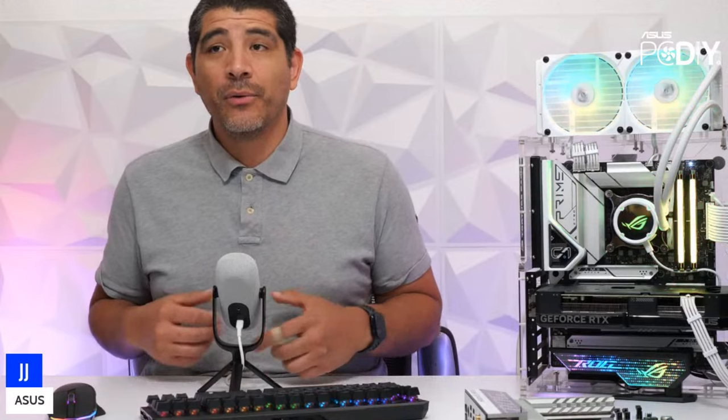So this one is going to be pretty interesting. This is an update for those of you that are big fans of having lots of M.2 based SSDs. I think some of you will know that actually I'm personally a fan much more of U.2 and U.3 than I am of M.2, because M.2 is more power constrained, it's more density constrained, it's heat restrained, right? So it's quite a bit more challenging, especially if you want larger densities, right?